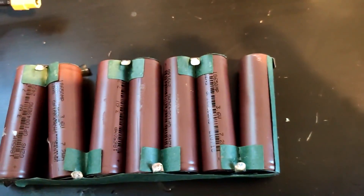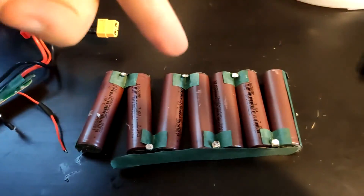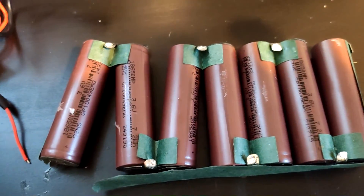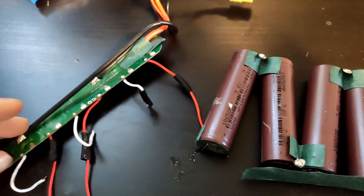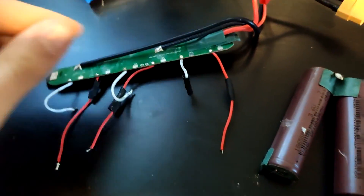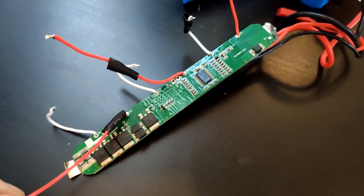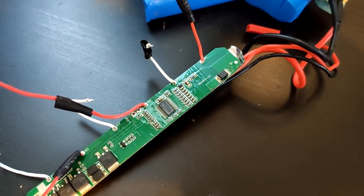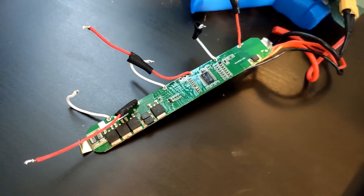So I've just finished taking it off, and here's all the balance cables and all the circuitry. We pretty much just have to move it over. These can probably be reused — if we actually wanted to, we could set this up with the battery and make it a 6,000 mAh battery, but that would mean having to make a bigger everything for it to work. So we're just going to stick with what we need. Let me just check — one, two, three, four, five, six. Is this going to be 6? It should be 7. I guess 7 because that one connects to the battery anyway. Okay, so I'm going to start moving this over.